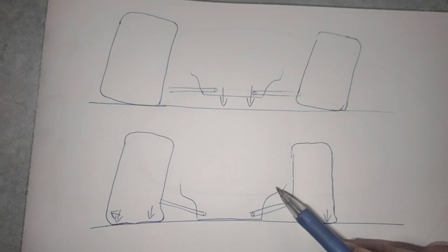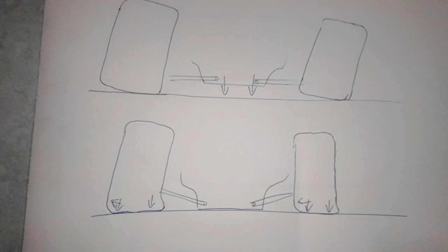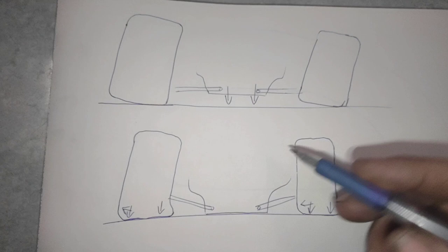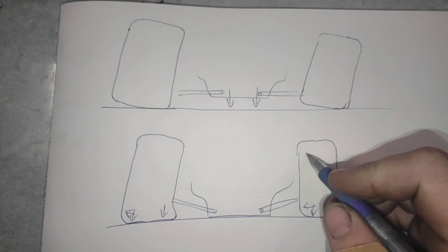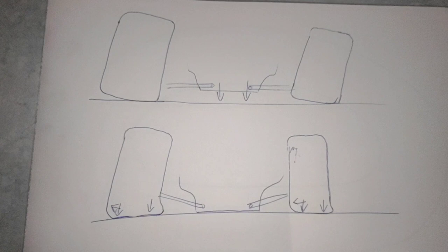In jacking force type cars, where you've got that shorter left front upper, you've got to run some sort of a stop. I've never seen guys run jacking forces without running some sort of a left front stop or a considerably higher left front spring rate. The reason is because this car is jacking. It's actually forcing itself down on this left front, which is basically forcing this left front up in the wheel well. By doing that, the cross weight goes up. The car sees a lot more cross weight past its center, right through its center and just past its center. And for that reason, it kind of makes the car lazy.